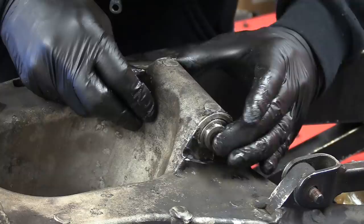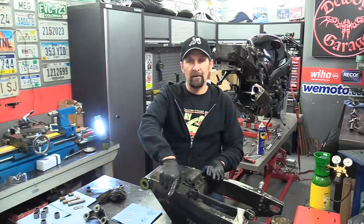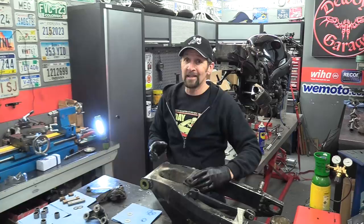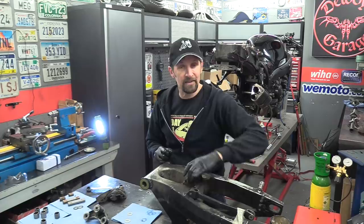Okay, right, with that, as you saw, I load up a load of grease inside the tube, same goes for this one, then you push the bearing tube through. As you push it through, it shoves out the excess grease, like a spud gun, it just shoves it out the other end, and I put it back in the tub. What I've got in there now is an internal tube that goes between the two bearings. It's captured by the oil seals, but inside it is a solid column of grease all the way around with hopefully no air in there whatsoever. And if there's no air in there, then there's nowhere for the water to sit at all, because the water won't displace the grease unless it's jetted in, and it ain't going to be. So that should last the lifetime of the bike now, hopefully. There we go, right. So they're all greased up, they're ready to go.